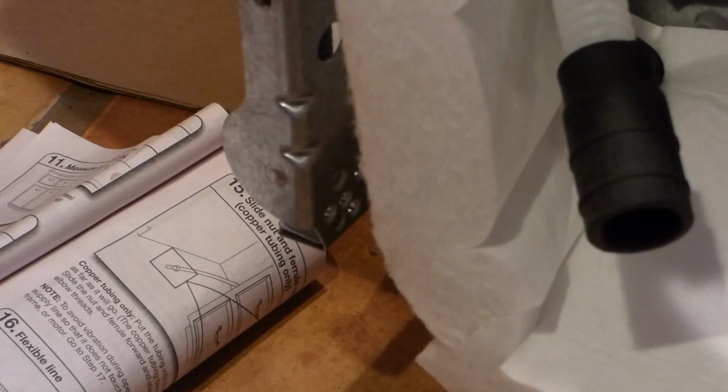Right, so you have your different holes for the different positions where it's going to go in. I'm going to figure that out, basically adjust it, because once you get this thing back in there, you don't have to pull it back out to adjust. When in doubt, though, you want your dishwasher tilting more towards the back. You want it leveled out, but if it tilts more towards the back than the front, that's good. If it tilts more to the front, that's bad. You can have maybe some water leakage, who knows.